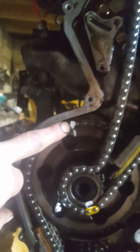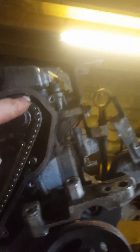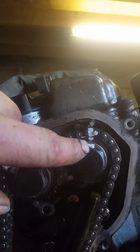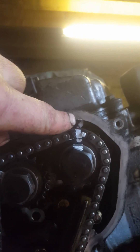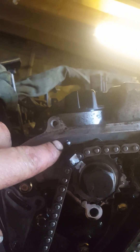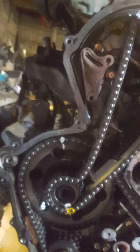Which lines up with the black mark on the chain. Come forward to the top chain - yellow mark lines up the pin. Follow the chain round, come back up this way because that's the side it stays tight. First black mark on the mark of the pulley, which also lines up the mark on the casing. Next one the same - blue mark, mark on the casing. So all we've got to do now is put the tensioner back on this side and you're correct.